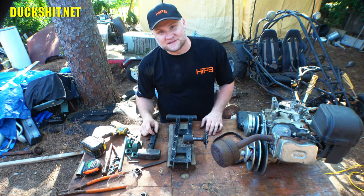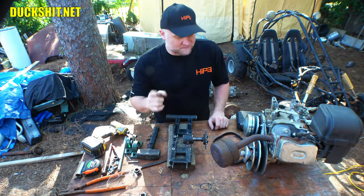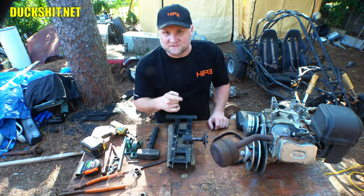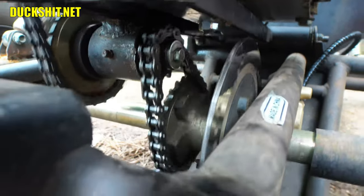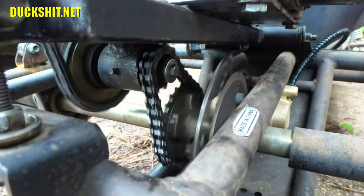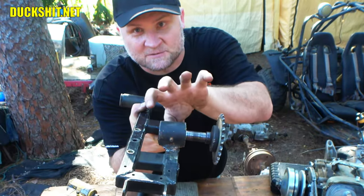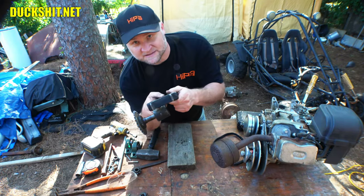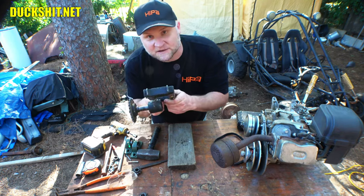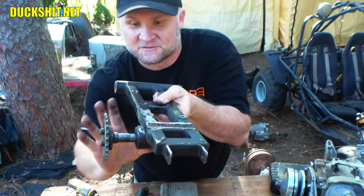I'm back today with my KT196 Go Kart. In particular, this is my Predator 301 engine. This made the weak spot on the Coleman KT196 very, very evident. The weak spot is right here in the jackshaft mount. It only attaches in one point to one of these 1-inch square tubes right here. And what happens is the engine pulls on this thing and it twists the square tube. In addition to that, the other side connects to the axle, and the axle is extremely solid and stationary, so it pulls against that and it draws itself down. So this whole thing is forced to twist.